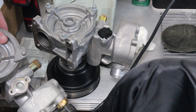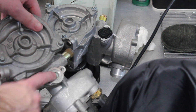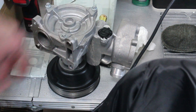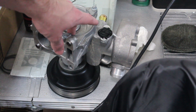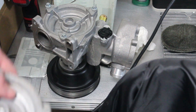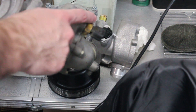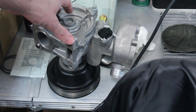We have the new water pump prepped and ready for installation. On the old one — this is a non-original replacement — you can see it has an optional flange on the backside with a freeze plug installed. On the new one, I installed the supplied freeze plug but siliconed over it just to ensure that any weeping is sealed. This is recommended in the most updated Mercedes service manual for this engine, which was not done when this was replaced at a dealership in 2005, but I'm doing it on this one per that recommendation. Now I need to transfer over the remaining parts from the old pump: the pulley is already done, plus a sensor and the thermostat housing. Once that's done, it should be ready for reinstallation.